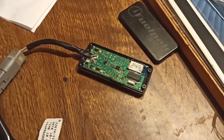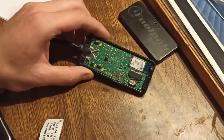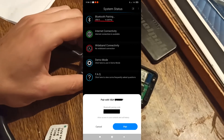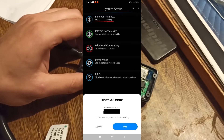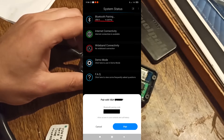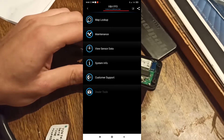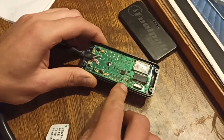When I first got this device, I connected it to my phone and powered it with a 12-volt power supply. I was getting part of the VIN code number of the previous bike, and there was a message that the device is linked to another bike. Then I tried to desolder the flash memory and connected the device completely without flash memory.